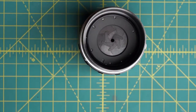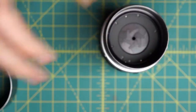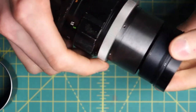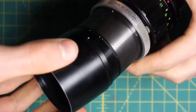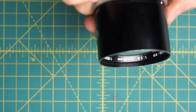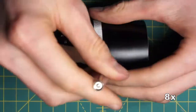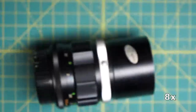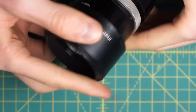That has the entire back section of the lens reassembled. To complete the front section reassembly, first install the front optical piece by screwing it in place, then slide the other body section in. There's a little white indicator on it that should line up with the depth of field scale and where the aperture currently is. Find the screw holes that line up and that has the entire lens reassembly complete. The lens hood just slides in place.